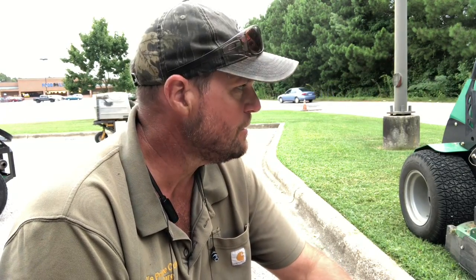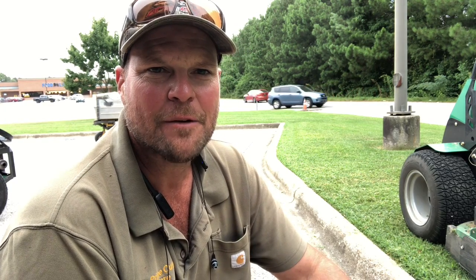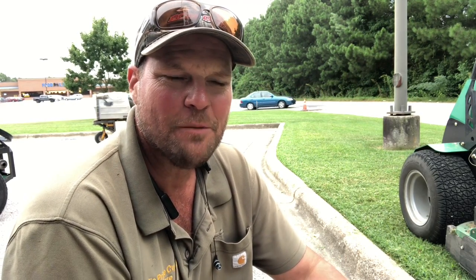That works fine, but the other thing that's hard on is when you got both front casters against that curb, and you push into it, you'll notice you surge up those hydraulic pumps. Well, in this case, the hydrostatic transmission on the Quick Cat. But I have seen regular ZTR mowers that people have blown a pump by pushing that surge it makes, that spike, when you push those two front casters against a curb trying to jump it. So keep that in mind. Be easy on your hydros.